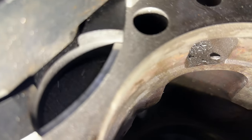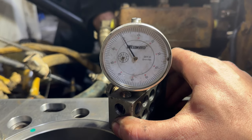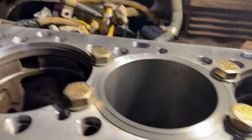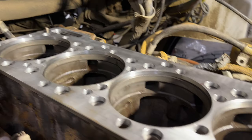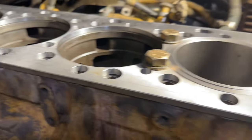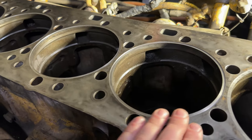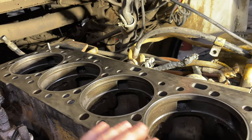That's nice. With the final cut done, we got our clamp back down again, gasket and spacer deck installed, zeroing back just under zero — pretty well bang on 8 thou. That's going to give our head gasket a nice squish, that's where it rides on. With the tool set up we can just go ahead and clamp it onto each cylinder, cut all the rest, and they're all going to be the same. We can put this thing back together and kick it out. All the cuts went very good, everything looks really good, so this thing's ready to be assembled and get back on the road. That's pretty much going to wrap it up for this video — thanks for watching.